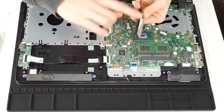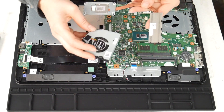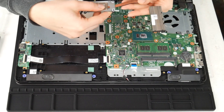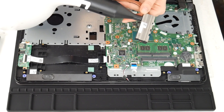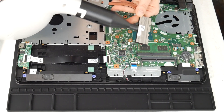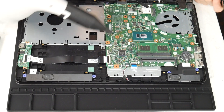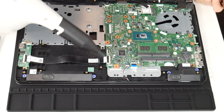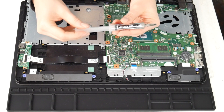Now that I've gotten the heat sink off, I'm going to clean out that little vent there because the fan takes the air and expels it through there and all that hot air goes out. If those two things aren't functioning properly, your CPU and motherboard can't stay cool properly. So I'm going to give it a good blast with that air cannon. I do recommend these air cannons because you can clean out the inside of your computer really easily. Sometimes you open it up and it's filthy because, you know, you use your computer for everything.